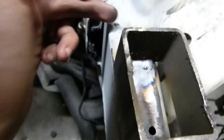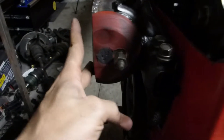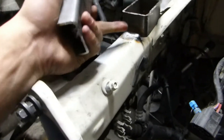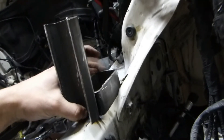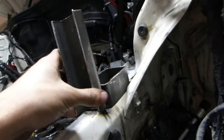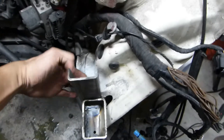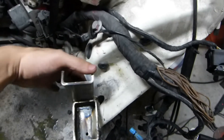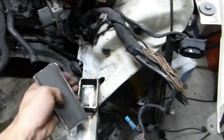We can also weld here and lock this plate into this piece and to the frame. The way this is going to mount up — we've got our chopped mount with the bolt going through it and the relocated hole. We've got these channels I cut out of some box steel with a hole through them going all the way through to the other side, so it bolts basically like that with another channel on the other side. I'm going to weld up another tab here which will allow this piece to resist rotation within this mount. In addition to that, I'm also going to brace from here to that bolt mount for triangulation to resist rotation — and that little bolt will hold it from flopping around when I'm trying to install the engine.